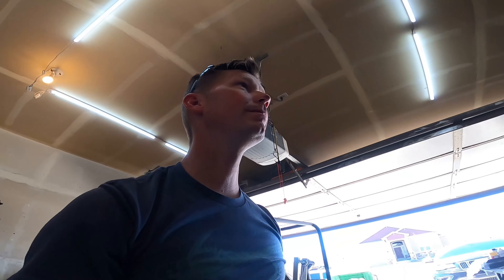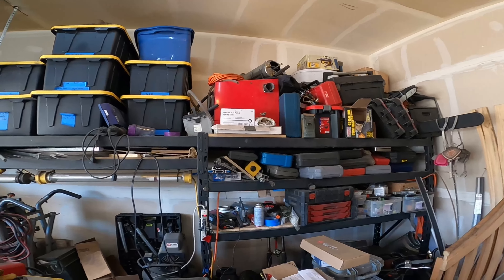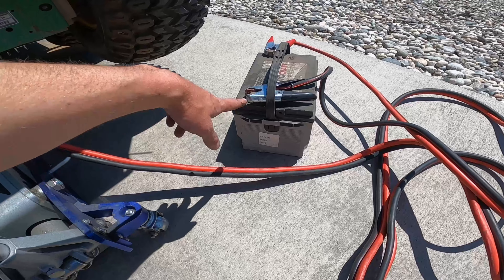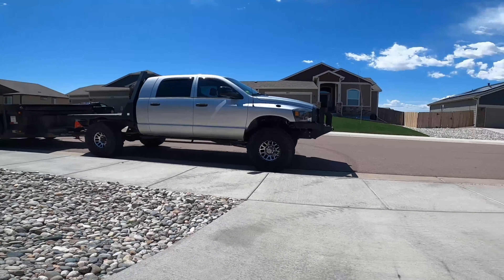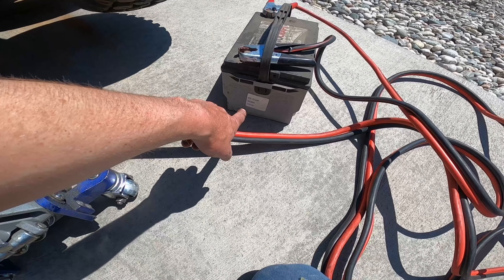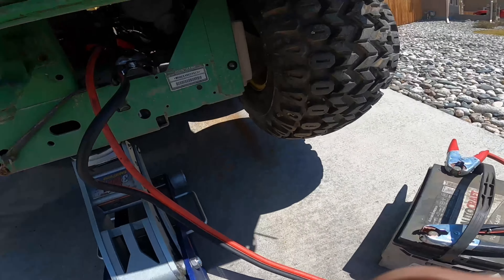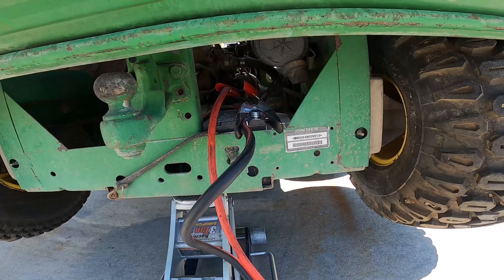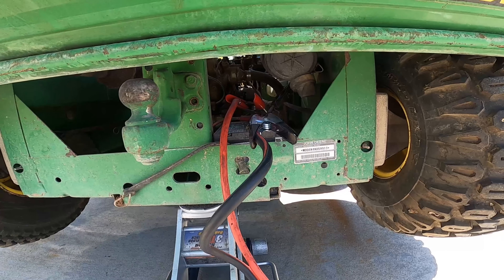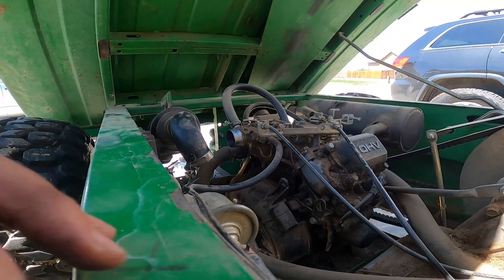Let's get a bigger battery — there's an AGM out of a Dodge and I should have a pair of cables around here. This is a Type 65 AGM out of a Cummins — that Cummins ended up with too many batteries. I bought that in 2015, killed one of the two but just replaced both, so this is just a spare I keep around for times like this. The old battery doesn't seem like it's shorting out, it just isn't good. We may end up just disconnecting it so the starter gets full juice. Now it's time to give her a go.